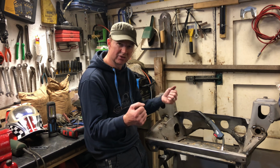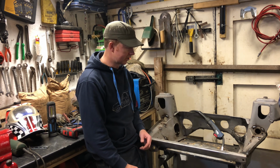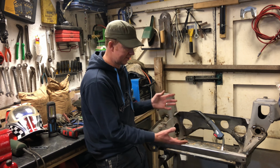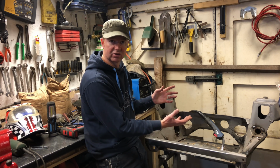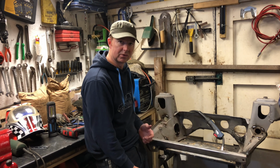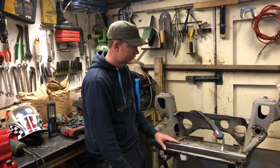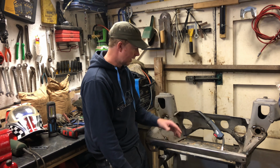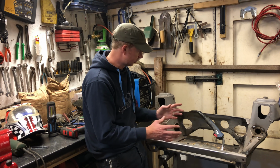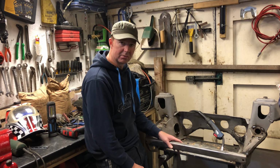Like I said, mostly when you're pressing on a bit and having a bit more of a sporty drive. But for the little bit of extra time it took me to do that, it's just nice knowing it's actually done. And the subframe can be removed and put into something else at a later date if I want to put it into a track car, and replace this subframe with something different in this Mini. I've always got this subframe, which I know is seam welded and also gusseted where it needs to be. There are some other places where you can put bits of gusseting in, but I'm happy with what that looks like, and hopefully, like I say, that'll make a difference.